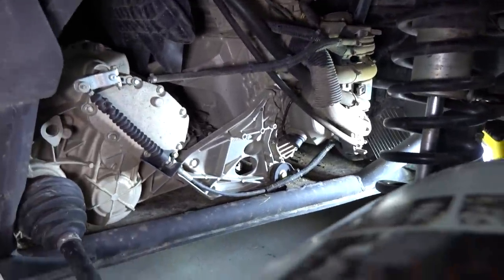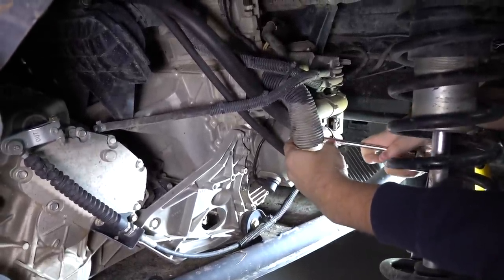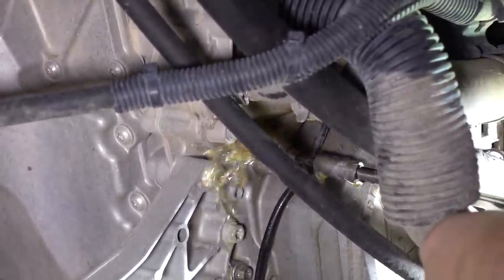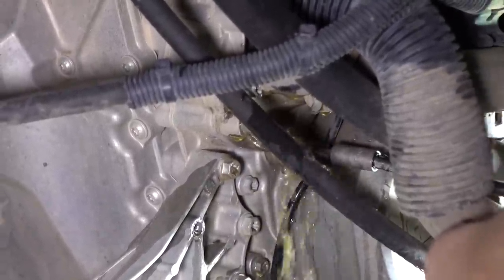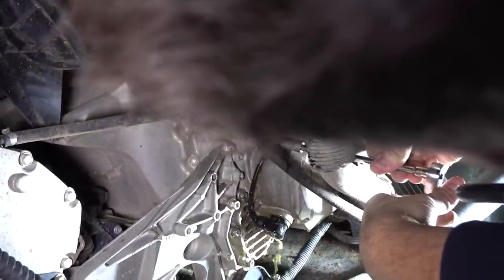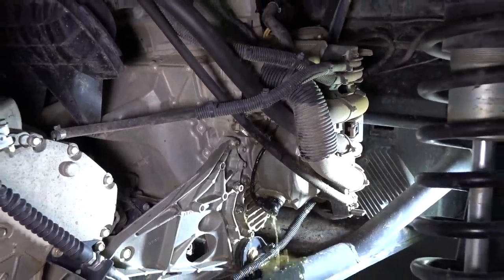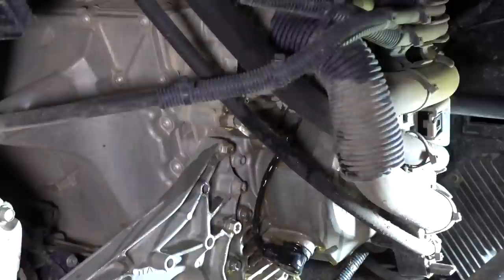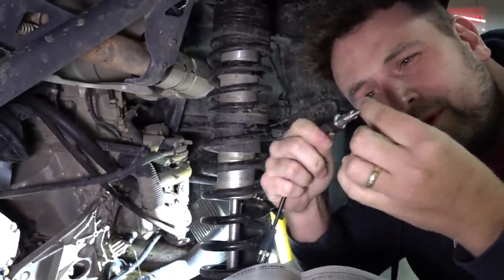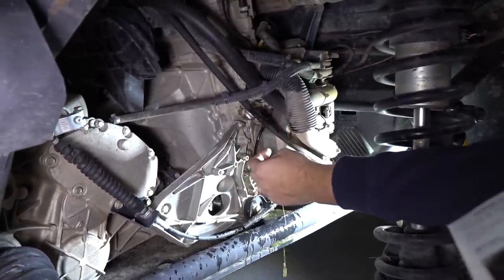Kneeling all day to work on stuff really sucks. We're going to lose some coolant here according to the instructions. Whoa - losing a lot of coolant! It's a little geyser. Really expected it to stop flowing at some point. The system is sealed so you'd expect that. Get the sensor in real quick. By the way, don't forget the copper washer - very important step. The copper washer is in. Okay cool.